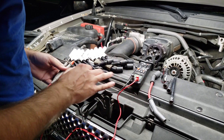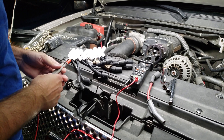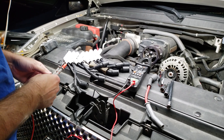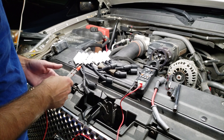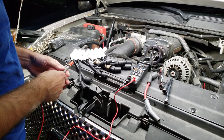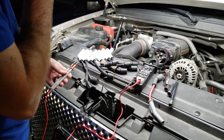While I had both sets of plug wires, I thought it'd be interesting to compare these two. Both of these are made for any Gen 4 LS, so they'll be a 2005 to a 2020 General Motors V8 — the 4.8, 5.3, 6.0, 6.2, or 7.0 liter are going to be compatible with these plug wires.